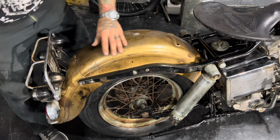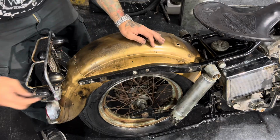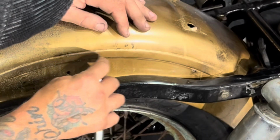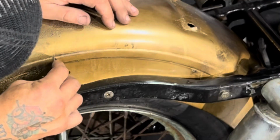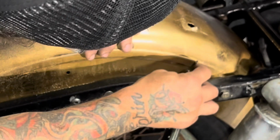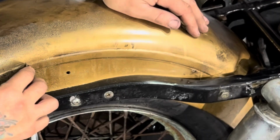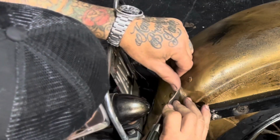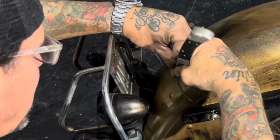I'm going to go ahead and work on this fender, and you can see I burned through a little bit of it on purpose. There's a couple spots, but you always get a little bit of wear right on the edge of this body line on the fender. So I'm going to scrape some of that paint through to the dark paint that's underneath of it. Just a few spots, and just a hair, don't need a lot. Some areas heavier than others. There's always a lot of chipping around the hinge here on the fender. The paint chips. So I'm going to scratch a lot in there.